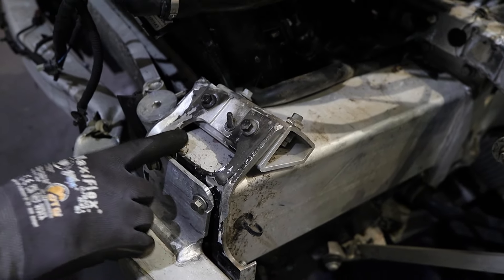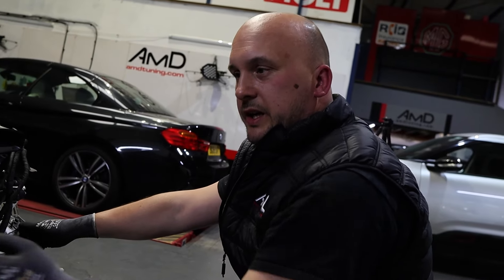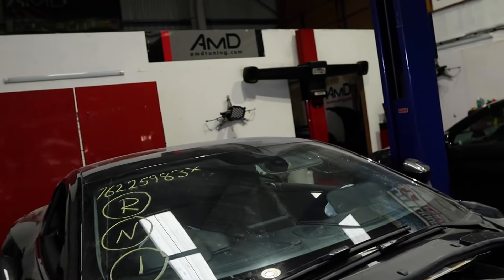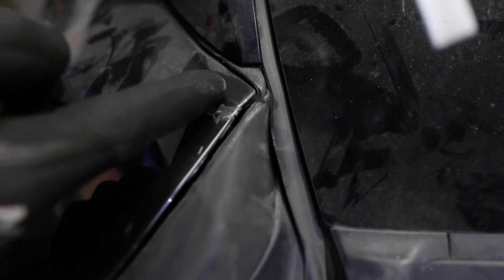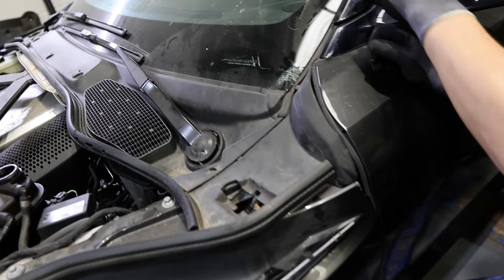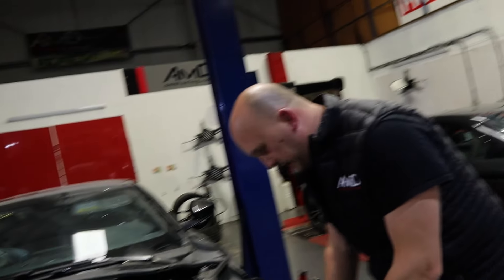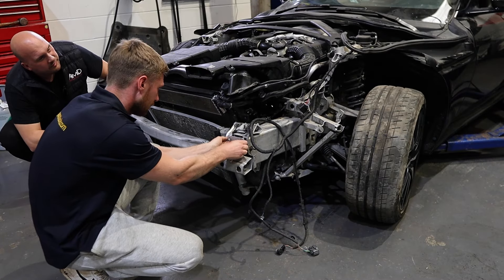I did notice this doesn't look too happy. So the bonnet hinges forward? Yeah, the bonnet hinges forwards. Bonnet, headlights - they're not going to be cheap. I've also seen the windscreen's cracked, that's not going to be cheap. I don't know if there's some paint damage there, or if this is PPF - it feels a bit rubbery. The wing here is all fine. The bonnet's gone back, and that's what's done the screen there, and obviously the airbag's done that screen. So realistically it might just be crash bar, rad pack, hub, bonnet, bumper, headlights - and I don't know if there's an auxiliary cooler.